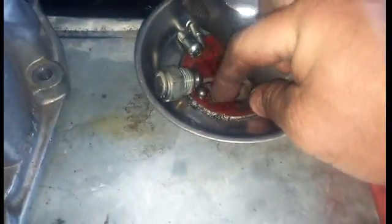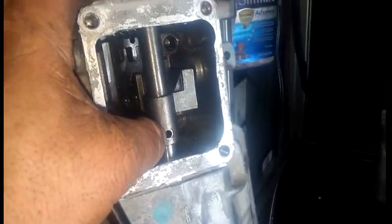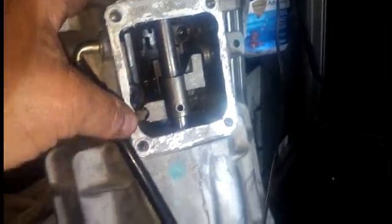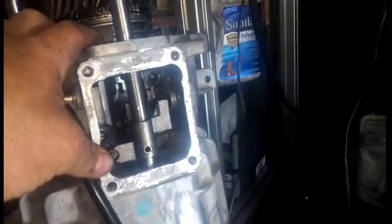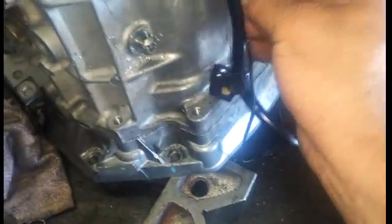A day has lapsed, and I finally have enough progress to update people on this. As for the little shifter pin that was giving me a lot of trouble, well, it's still in there. What I was able to do — here's the shifter ball that was in there — I was actually able to take a very thin screwdriver and pop the ball out. It's just holding onto the rail by a thin margin. I'm probably just going to put a drill bit in there and just drill out that little bit of pin. I'll just use a new pin when I reassemble it. I don't know why this one gave me such a hassle because they usually just pop right out. The other thing that's been a complete nightmare are these shift rail pins. These actually place the shift rails in the proper position. Without them, your trans won't shift right. The problem is it's a steel pin in an aluminum case and they tend to kind of bond to the metal.